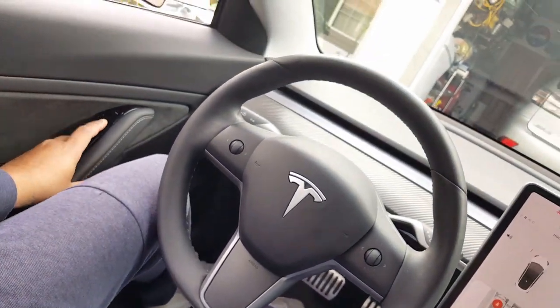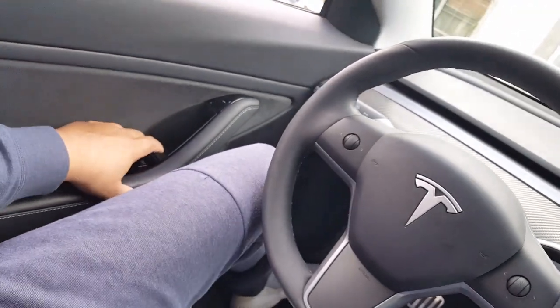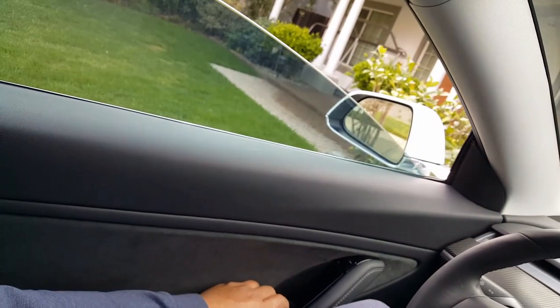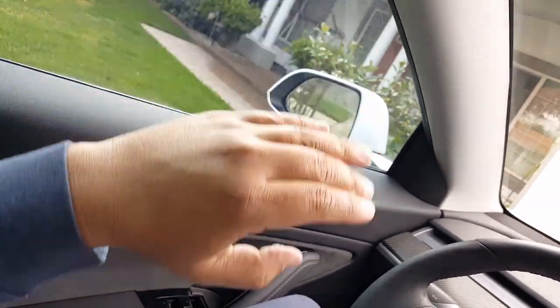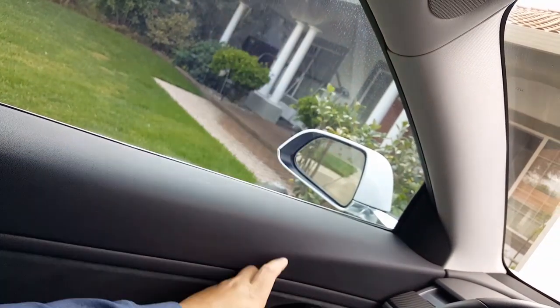It just has a little push button electronic that releases a door. The reason why is, the windows will roll further down so it doesn't ruin the seal. So when this is pushed, it tells the window mechanism to roll down a little bit because you're about to push the door open manually yourself with just your arm or something. Watch. Maybe you can see a little bit due to the little window stains here. You can see it pull down when I push the button.